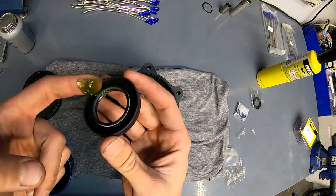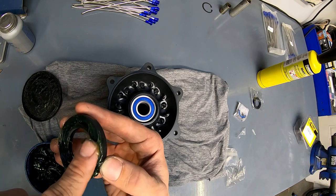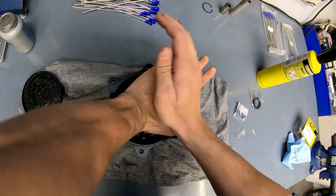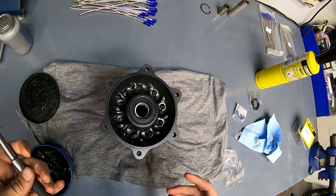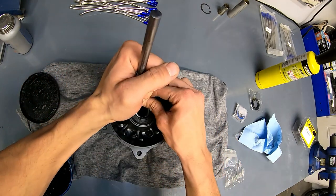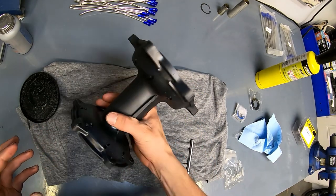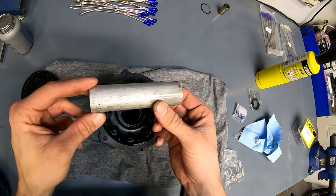I've got a brand new seal here. I'm going to pack the inside of it with grease, just trying to get it nice and even — it doesn't need to be too excessive. Then that seal should just press right in. You can give it a little palm action, which will usually get it done. If the seal doesn't go in perfectly straight, you can use a tap or socket to apply nice firm even pressure on the side that's a little high. And don't forget your spacer — I've done it countless times.